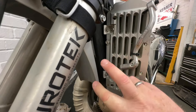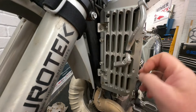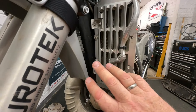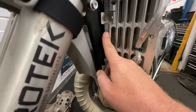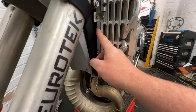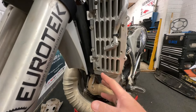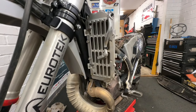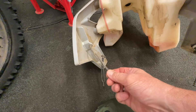These radiator braces come with pre-drilled holes and they're already tapped — M6 tapped. I don't know why they've got them as standard, but it makes it so much easier to fit this setup. These bolts are the same as what you'd find in the lower fork guards, where they've got a nice flange to hook the rubber strap over. But you could buy or make some sort of bracket to hook a strap onto if you wanted to.